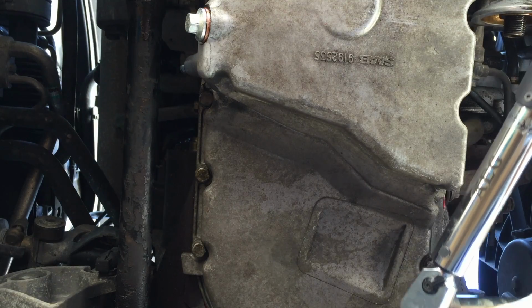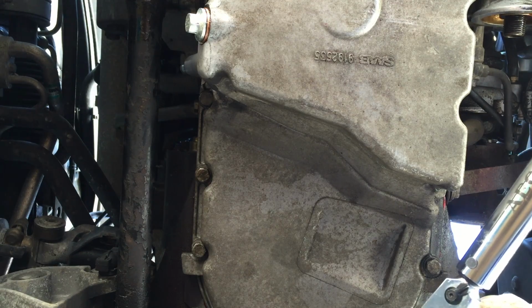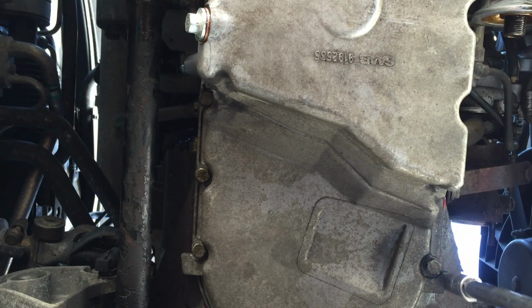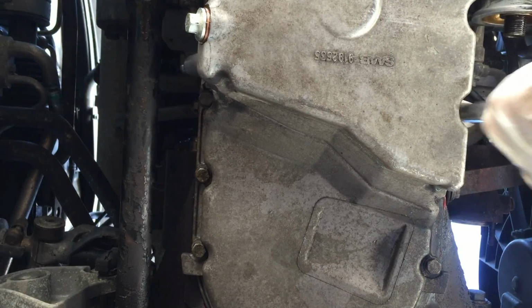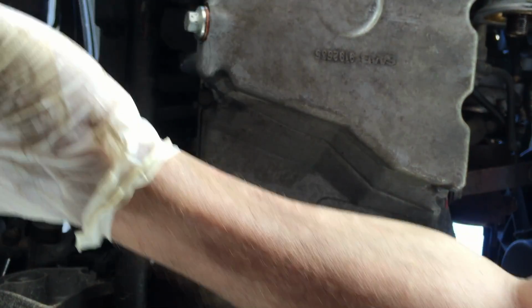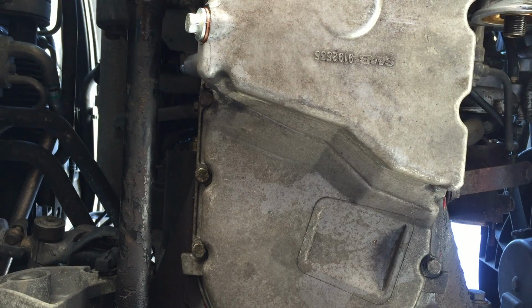It's a dynamometric key, I don't know in English, clé dynamométrique, and the torque is 22 Newton meters. When I screwed the bolts, I did it by crossing. So it means if I tighten this one, after I go here, and after this one, and after this one, crossing like that, you're sure that the whole pan is really well fit. Voila.